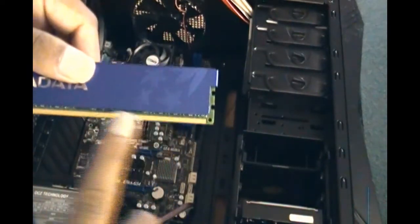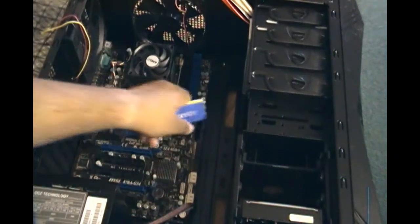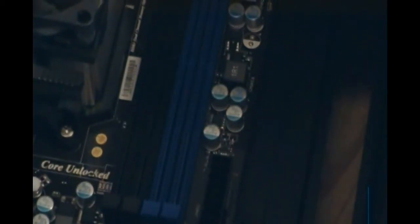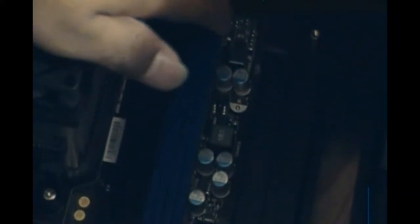As you can see, there are pins on the bottom and one side has more pins than the other — this tells you which way to align them. If you look on the motherboard there's a slot here that tells you which way to install it. The side with the lower pin count goes upward. Make sure the two clips are open, put this in there, slide it in straight — don't try to bend it or force it if it doesn't go in. Then just clip it in.